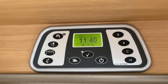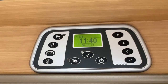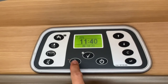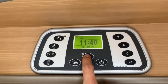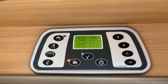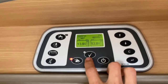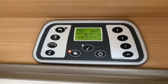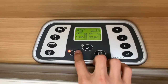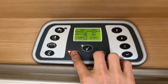If you want to charge the vehicle battery when storing the vehicle — doing a week on the leisure and a week on the vehicle battery over winter, which is fine — you've got a button here. To press it, you have to press the tick first, then press and hold it, and it will charge your vehicle battery, keeping the engine battery topped up when not in use. When actually using the motorhome, you always want the leisure battery to be the battery in use.